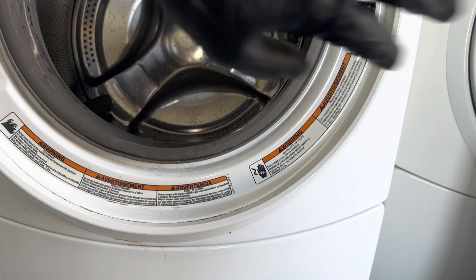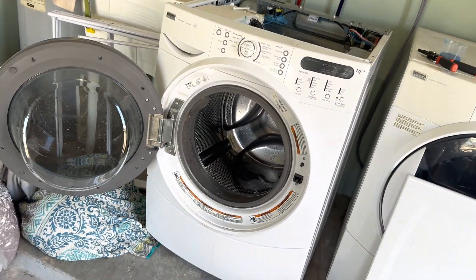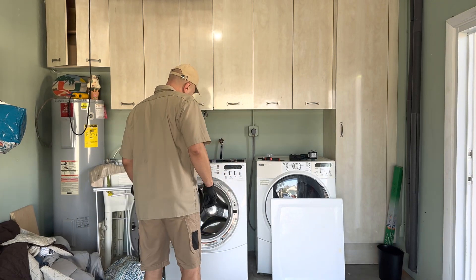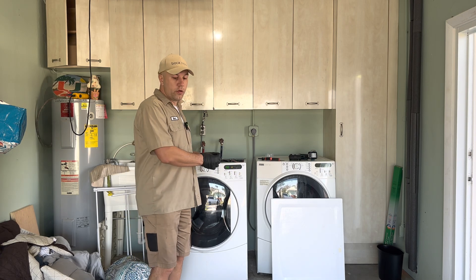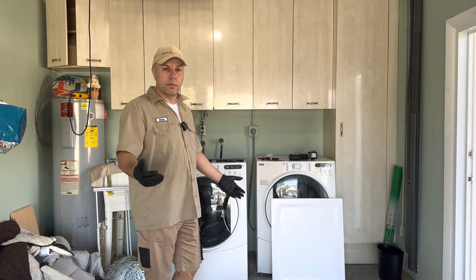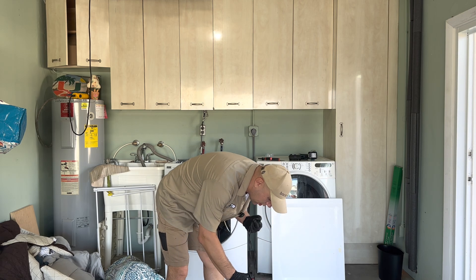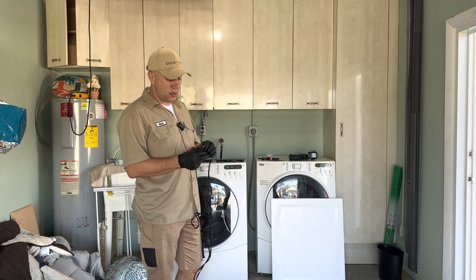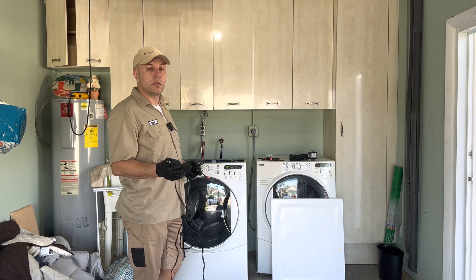I found water inside, and usually yes, it's a problem with the drain line — drain pump clogged, blocked, or malfunctioning. It's easy to fix because this machine has a special access panel. I don't need to remove the whole front panel. I opened it and first I checked power on the drain pump. I found power, so I started it. I used my 'kamikaze wire' — I attached it to the drain pump and plugged it into 120 volts.